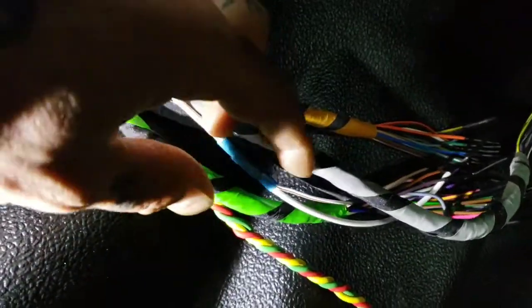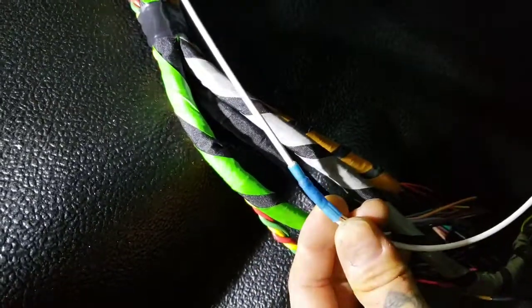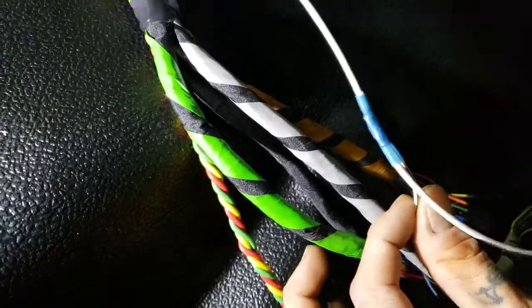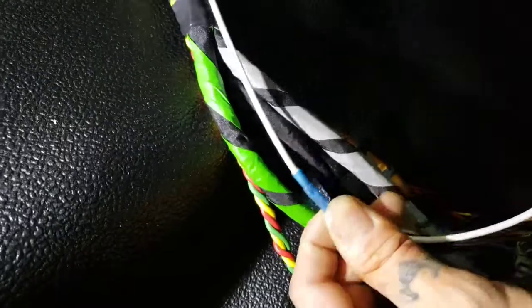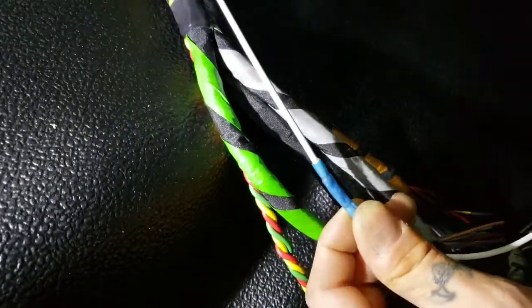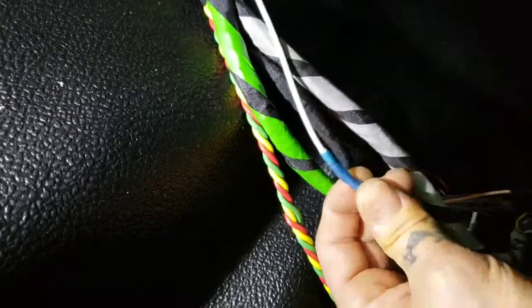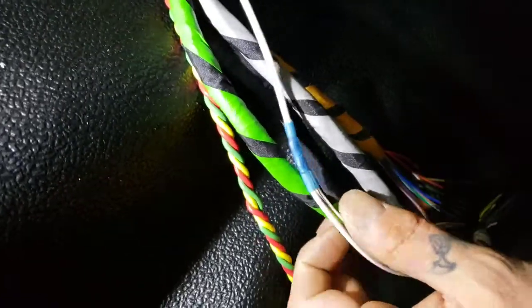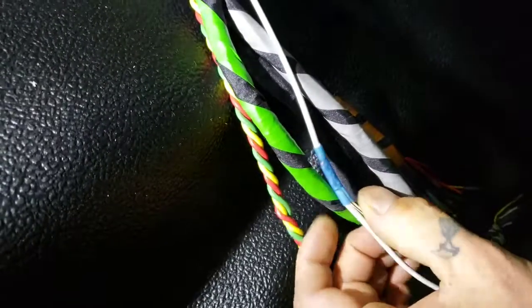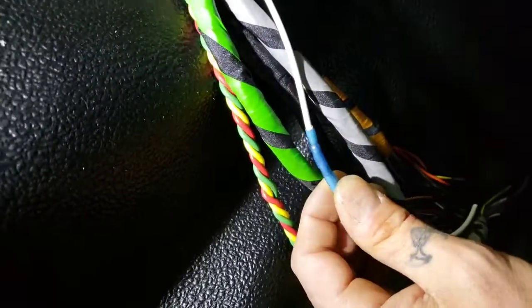Okay guys, so we got the white-brown from our green harness connected to our ground, and the ground continues out of it to go to our relays for our other functions. Now this is for your rear bulb detection on the green plug — white-brown wire — you want to ground this. You want to ground this before you unplug your incandescents from the rear. If you hook up LEDs in the rear before grounding this, even once you ground it it will tell you your rear lights are still out. So you need to go back and hook up your incandescents again, then turn the vehicle on and cycle it — it will say they're no longer out. Then come back to grounding this wire, and then you can take your incandescents out of the rear and put LEDs on.